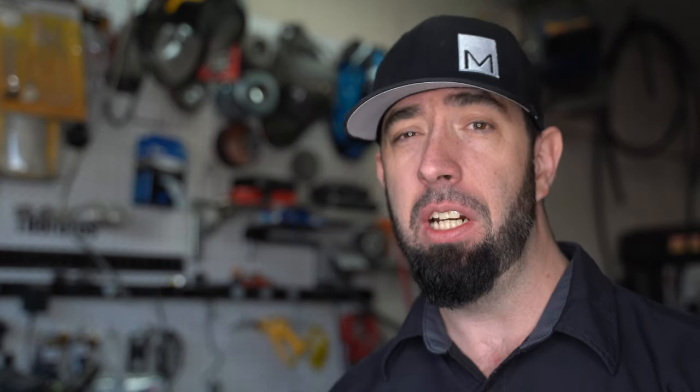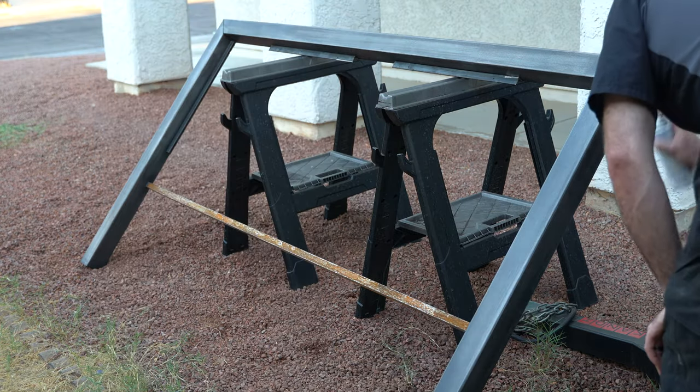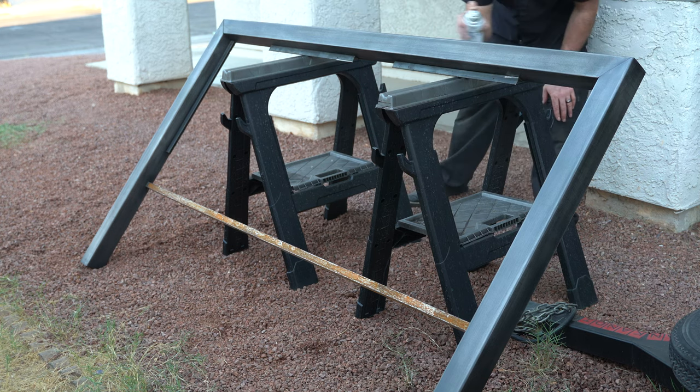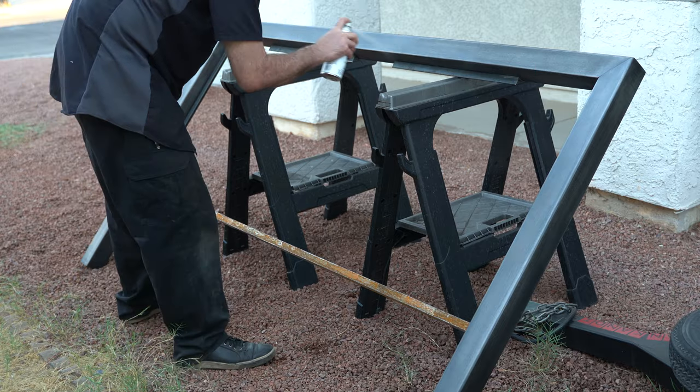Now it's time for clear coat. Clear coat is necessary because even though it's a different color now, the metal is still bare, which means it can still oxidize, still rust, and change color over time. Also this finish is technically a rust itself and rust rubs off — the clear will seal it so our hands won't get black and ruin our sheets. I didn't want a shiny look so I went with a matte clear. I can't really express how excited I am with how this finish turned out, but I've decided to use this method on the bed floor in the Mighty Max. My original plan was to do a wood floor and either char it black and cover it with epoxy or somehow dye the wood pink to match the paint, but I think the gunmetal wood grain will look so much better.